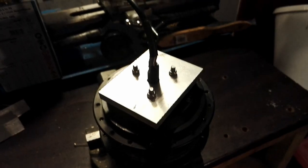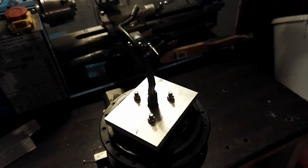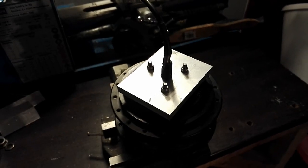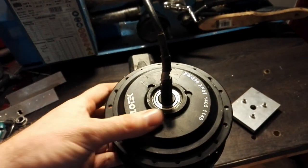What you can do now is turn the hub motor upside down, fasten it in your vise, and then open the cover by rotating your wheel counterclockwise. That should work fine if you don't make the mistake I did.